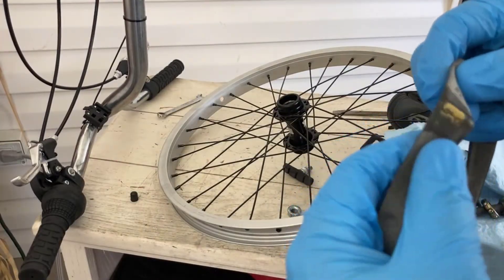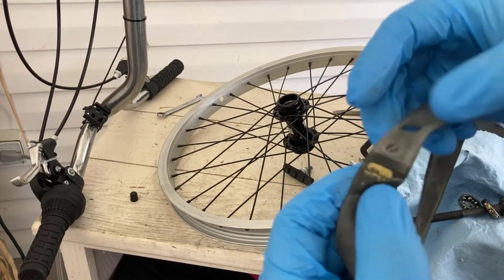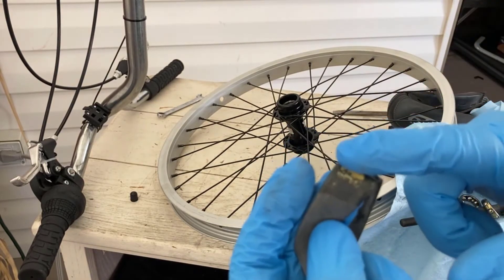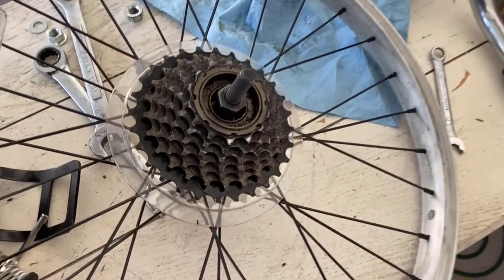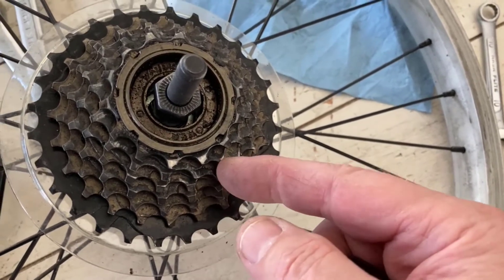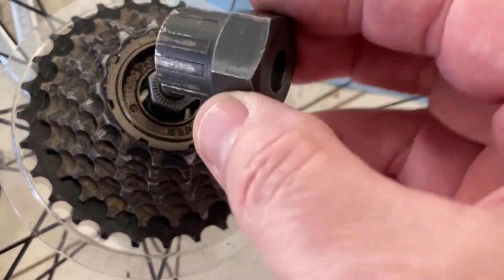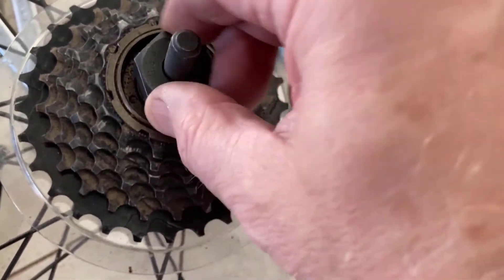Another thought: as I was pulling it out, it had glue right here next to the valve stem — it's probably a good idea to tack it down, but I wouldn't know what to use that wouldn't eat up the rubber or metal alloy, so I'll let it go. If you're working on your own bike and pulling the cassette off, this thing goes in one direction, so it's easy to go on — it's just screwed down, but very tight and requires a specific tool to reach the inside threads to pull it off.